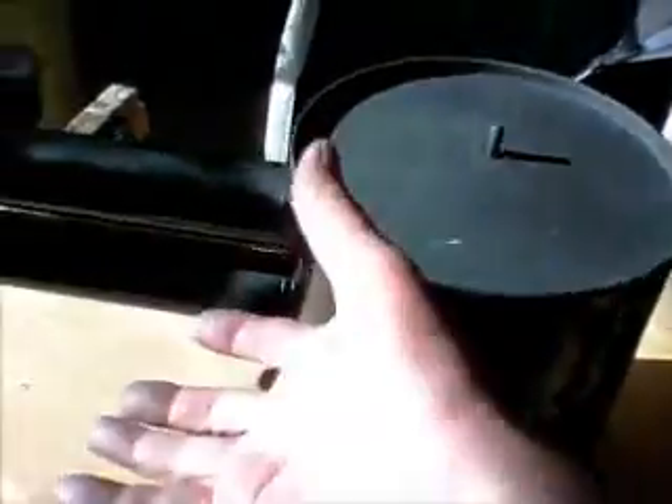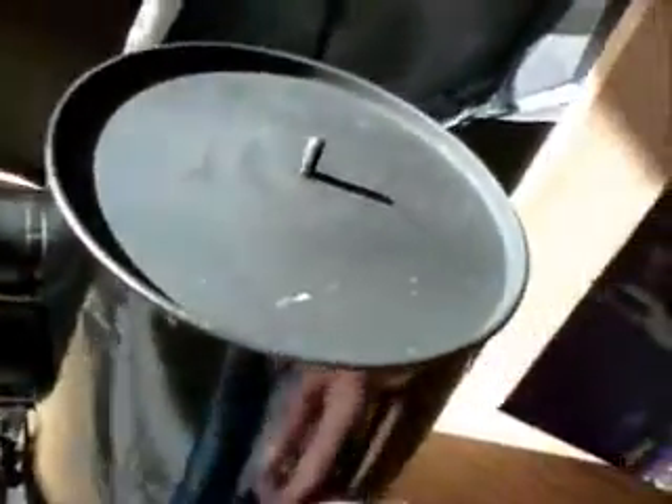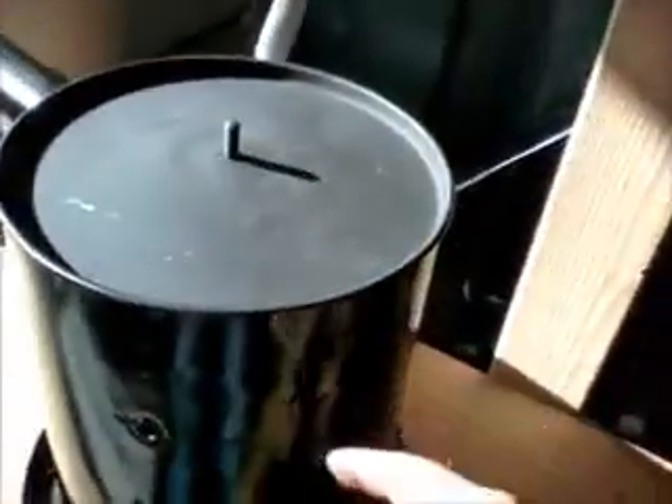I painted my air filter canister — remember, we've been talking about it for a while. I painted it with rattle bomb enamel and it's coming along. It's got a couple of dry spots because it was turned upside down on its top, so I need to come back and get those spots and do the bottom as well. I'm pretty happy with the way the outside of the canister turned out. I had to do a little body work on it in a couple of spots — it was pretty banged up. Hammered and dollied some of that out. I had a huge flat spot, but that area's where the bracket goes, so it'll be covered by the mounting bracket and the side of the car.